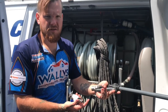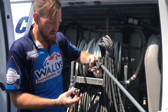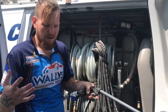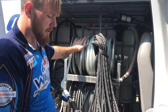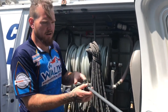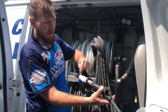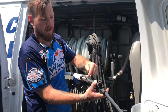Say our O-rings are failing, so we're gonna have drips, you know, we're in the field. Keep this in mind if you ever decide to go to pressuretech.com and purchase one of those kits. I mean, there's a lot of websites selling the soft wash kits. It's $300, $400, or $500. It comes with the pump, your hose, and they even have the soft wash gun, but it's a very basic setup and fittings. All they're gonna give you is the gun, the J-rod, the gun, and at the very bottom, instead of all this, they're literally only gonna give you the half inch male thread to the 5/8 hose barb right at the bottom of the gun.